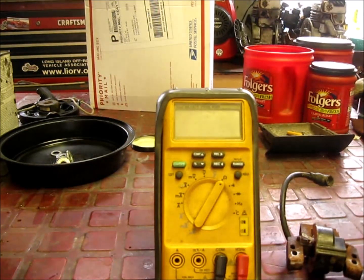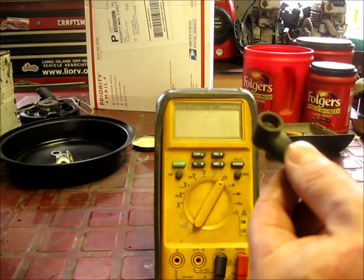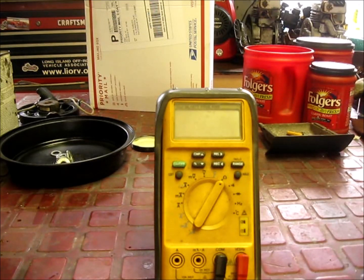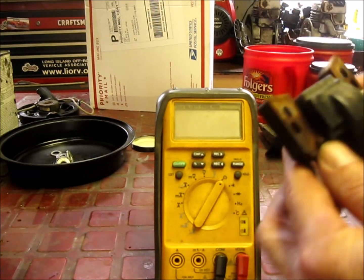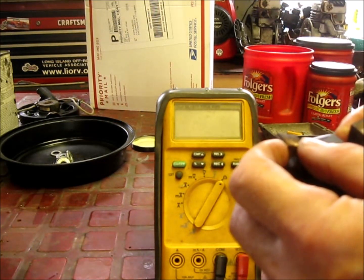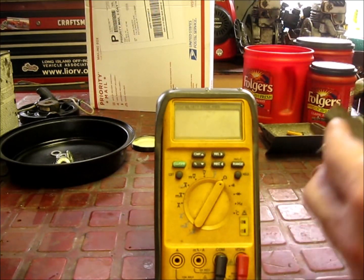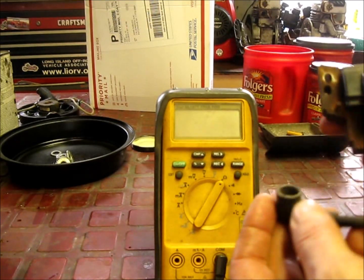What can you do? The first thing I do is wire-wheel it, then put a little acid on a Q-tip in the primary because I know that's dirty, and get it cleaned off. Then we'll recheck it, because sometimes that's the issue. I always say lubricate and oil them, because the laminates get all messed up when they get this much rust between them. Sometimes the electronics burn out from heat, but sometimes it's just bad grounds.